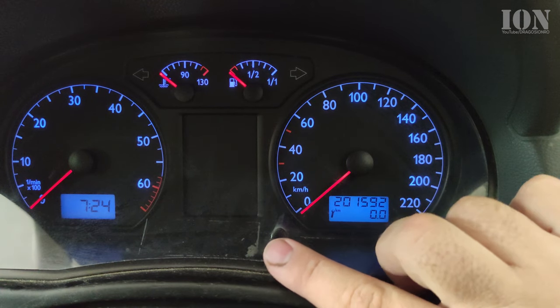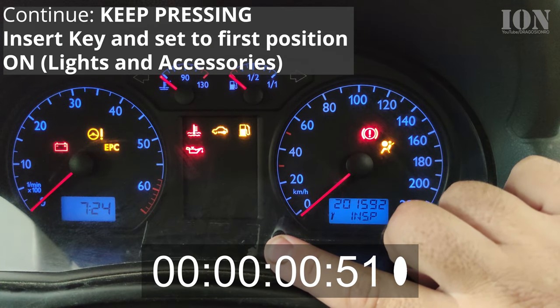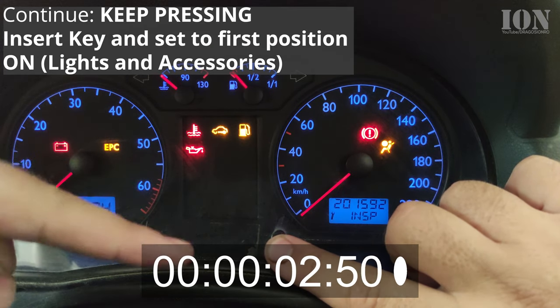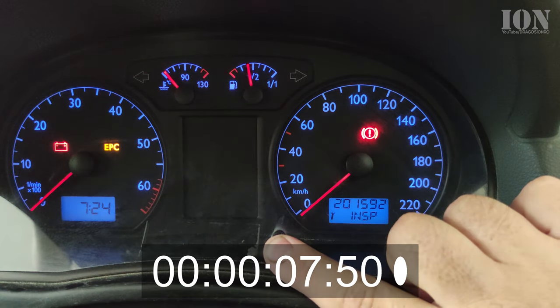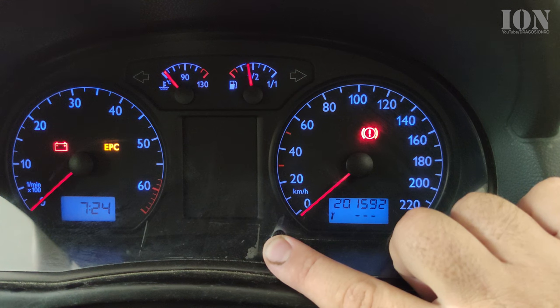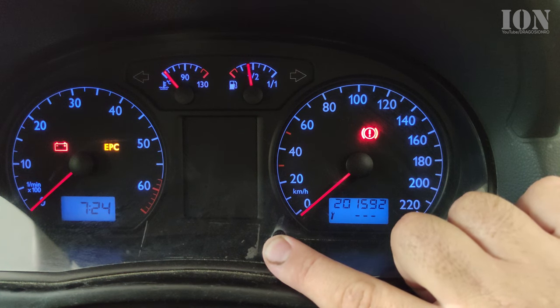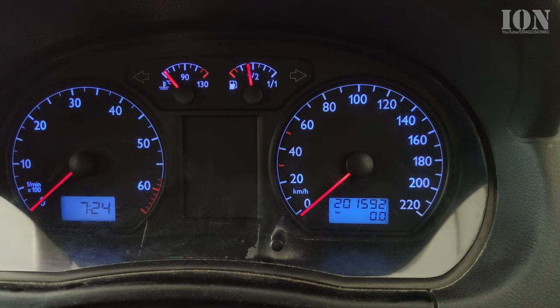The right way to do it: you start pressing the button and then you put the key on, and you keep pressing the button — leave the key on — for about 10 seconds. There, that's when it shows three lines like that. You can let it go. I didn't even have to start the engine. All you have to do is press the button, put the key on, keep pressing the button for 10 seconds, and leave the key on — that's all.